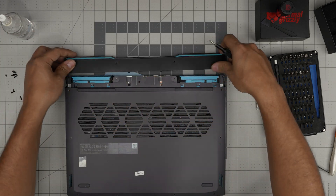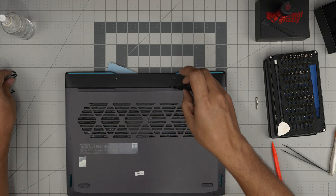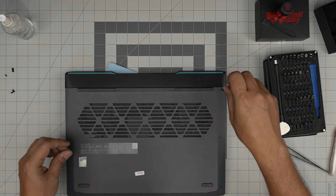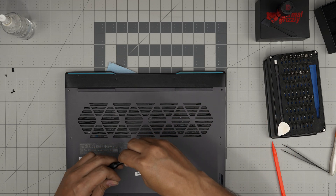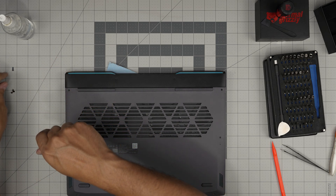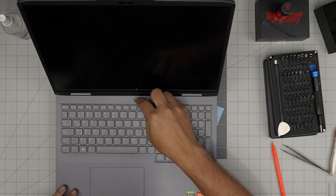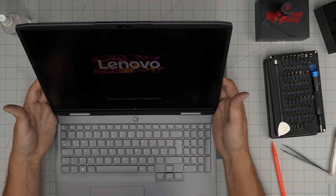Grab the grill, bring it over evenly and gently push it straight in with no force — it should click into place. Put the rest of the screws back in: remember the short screws go in the front end, the long screws go everywhere else. Always attach the back grill before putting in the corner screws, otherwise the grill won't seat properly. I hope this video helped — leave questions or requests in the comments. Thanks for watching! I'll power on the laptop at the end so you can see it boots up successfully.